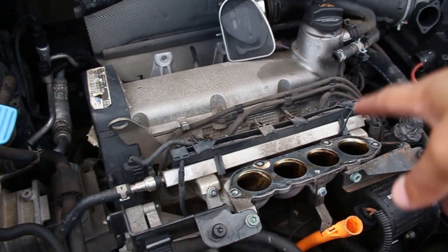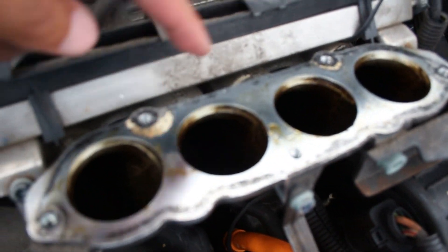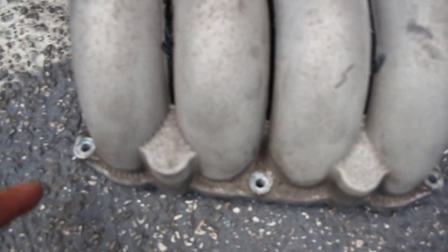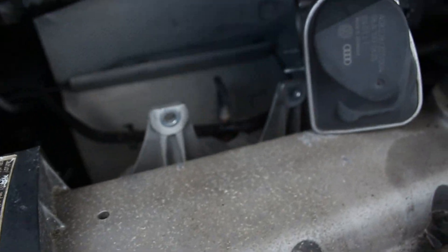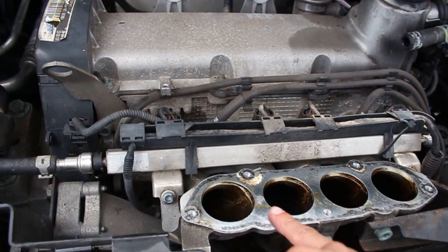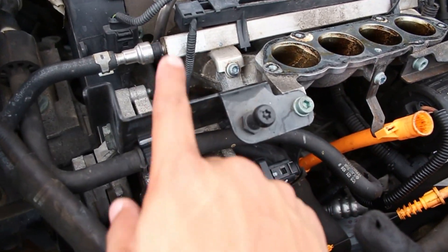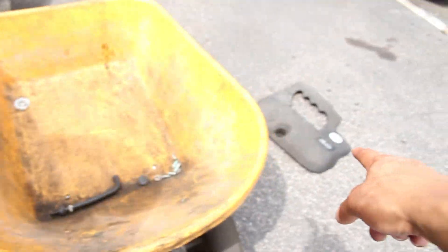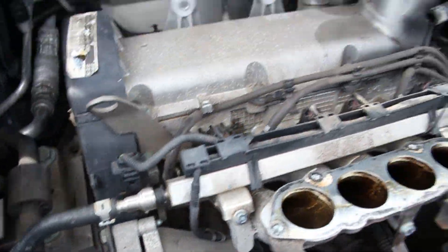After a good little while the top manifold is off. There are two bolts in the back you can't see, plus three on the front — and then two more hidden that I didn't know about, which are a pain. So five on the front, two in the back, then you pull the throttle body off and all the rest of the lines, and it's out. Now I'm going to pull the lower intake manifold, the valve cover, and the intake piece off.